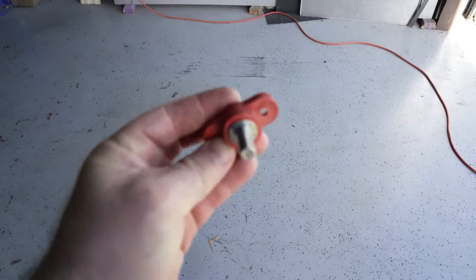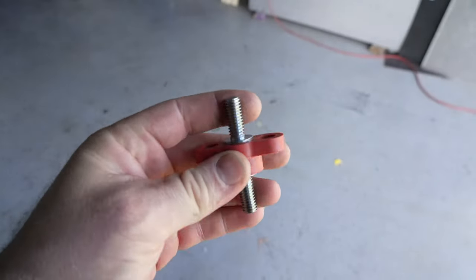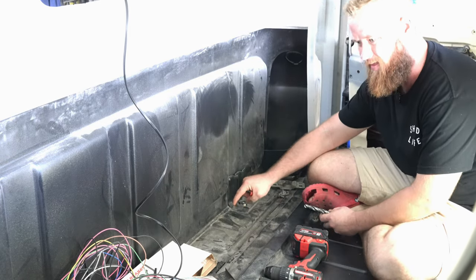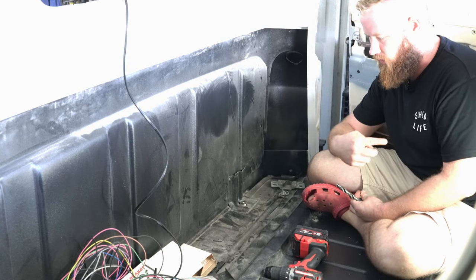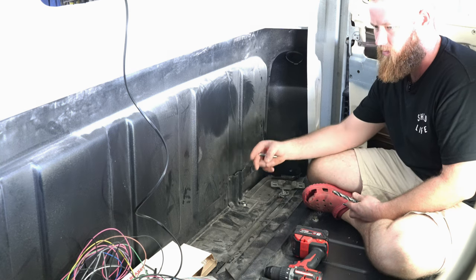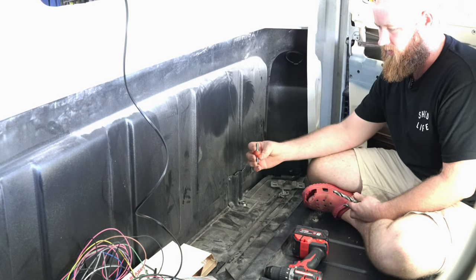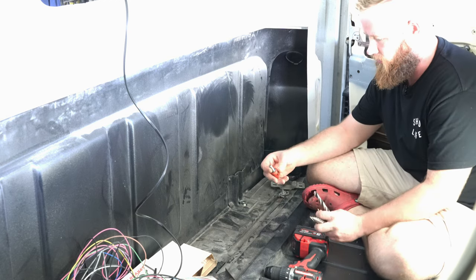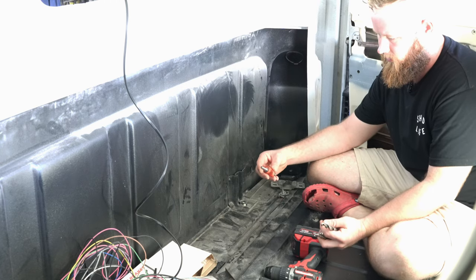This little piece here is the pass-through that I'm using for running the positive cable from underneath the car, where the battery's going to be, up into the cab. I'm going to punch this hole through here and run the start at the back. That way I can run a smaller gauge wire into the fuse block to run the engine and the accessories inside the car. I can also pick up the point in the back when I install an amp and things like that. It's going to make it a lot easier and it won't be underfoot, being behind the seat. Hopefully nothing will ever hit it or arc out on it — we'll have a protected boot on it and keep it as safe as possible.